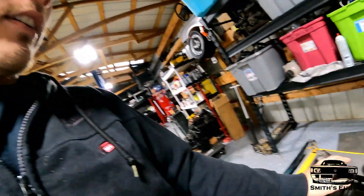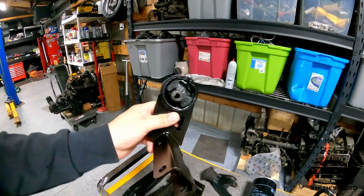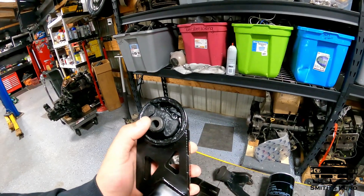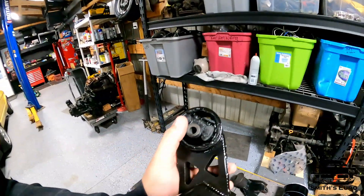To take care of the trans mount side, I got this stuff from Tech 53, which is a pretty good company — very nice design piece. I did not get poly bushings for this; I wanted OEM mounts because OEM mounts last a long time. An original Mark I engine mount or transmission mount fits in here — it's 64 millimeters — but an original trans mount is really hard to find. The last letter in the OEM part number would be a D; this one was an H. I don't really know the difference but the H was available and I was able to get it same day.